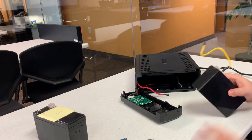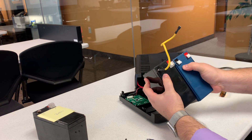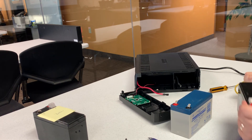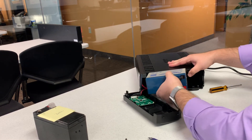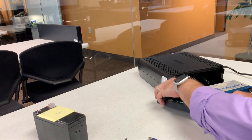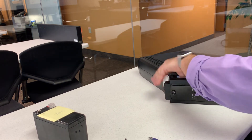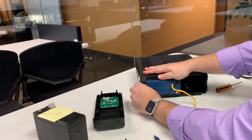We're using the generic batteries — I'll leave a link down in the description. We've got negative here and positive there, and the only thing we need to do is pull off the prongs. Go ahead and pull that yellow one off, which was on the black — that's ready to go. Then go ahead and slide this guy right back in. Be careful of the ribbon cable as you push this in — you don't want to hurt the ribbon cable.